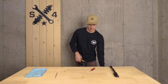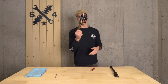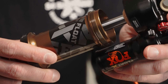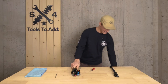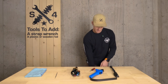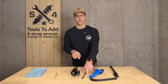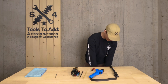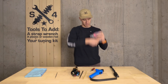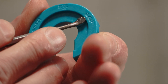What if you have something a little bit different — something similar to a RockShox Super Deluxe or even this Float X that we're going to work on today? The big difference is this has a screw-on air can, so we're going to add a strap wrench. We'll also want plastic, wooden dowel, or chopsticks — I'll explain more about that in just a moment. You'll also need your tuning kit, which has a variety of different colors and size clip-in volume spacers. Today I'm going to go with the 0.4 cubic inch spacer for this shock.